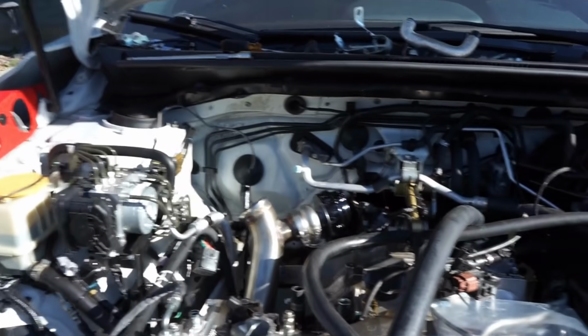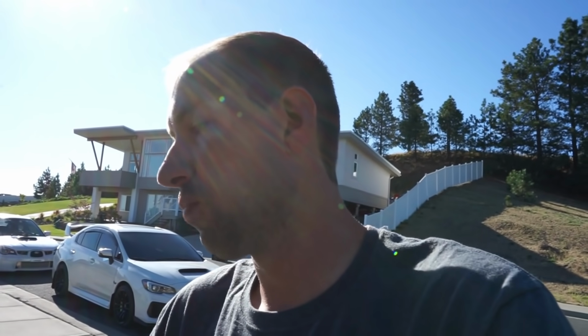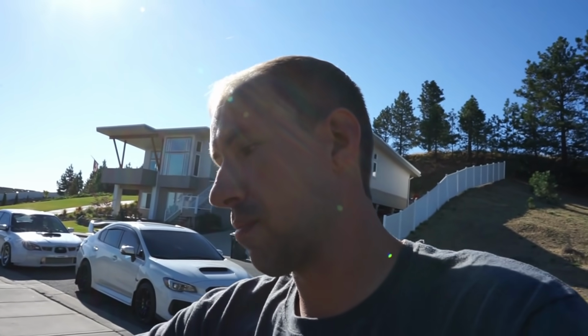Today, the plan is to hopefully get this thing all the way together. So starting pretty early. Thankfully it's cool out. But next step, we're going to get the turbo on the car and get these lines obviously tucked over first, then get the turbo on, get the downpipe, mid pipe on. Then we have our turbo kit on over on this side of the engine.